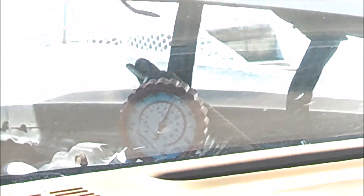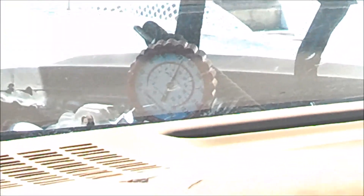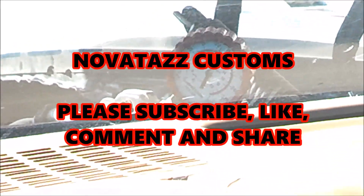Definitely not a compression issue. We definitely got something else going on. I'm going to guess it's got to be something in the ignition — whether timing's wrong, maybe a bad rotor, bad cap, or maybe a bad spark plug wire. But I have spark down to the cylinder, so I don't know. That's how you do a compression test. This is a 1979 Trans Am with a 403 Olds, and they seem to be all running around 150 PSI.